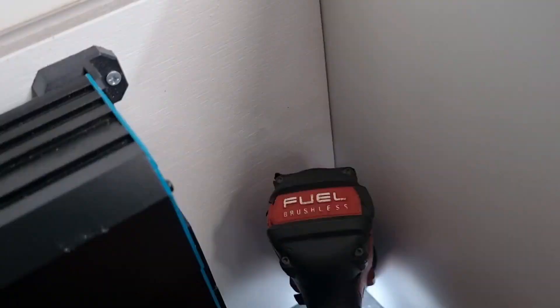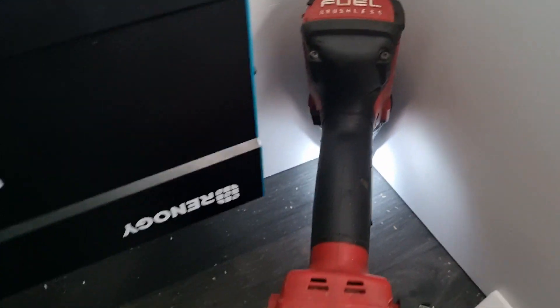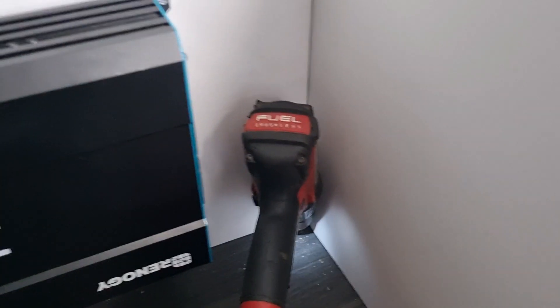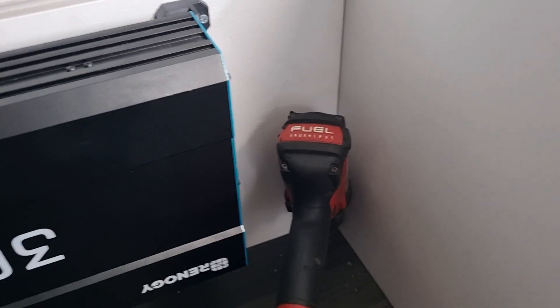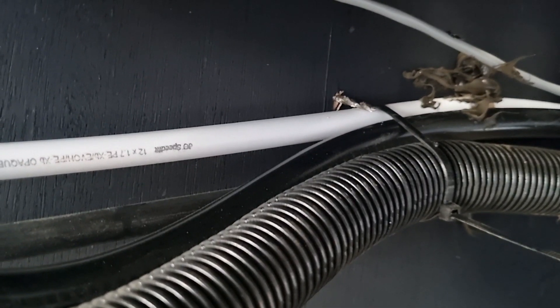What I'm going to do is use a drill with a small drill bit and drill in the area I want to go through — because if you stuff it up, at least it's only a tiny little hole and it's easy to cover. Just drill a little hole, go real slow, then leave the drill bit sticking through the timber and go underneath the caravan — you'll be able to see exactly where it's come out.